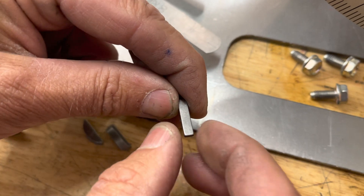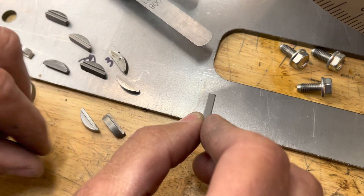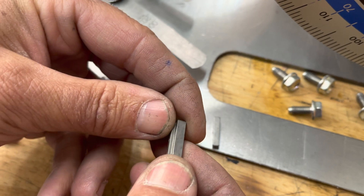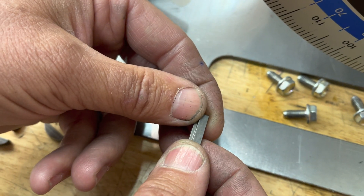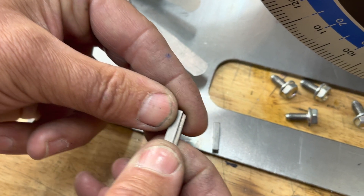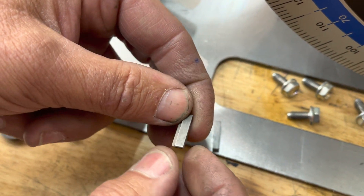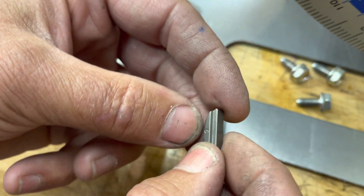On the other side, it's just a straight flat key. That's what these engines come with from the factory. Now you can take this key that's notched — this has a six in it. Depending which way you put this on the shaft, you can either advance the timing or retard the timing. This would go on to the crankshaft. This is in the retard position. This is in the advanced position. This key is a number six — that's pretty aggressive. See that slot in there?